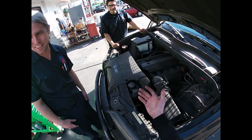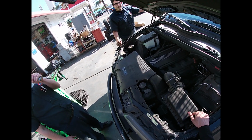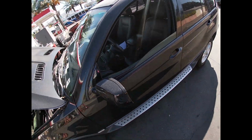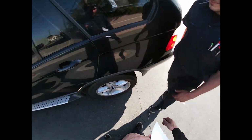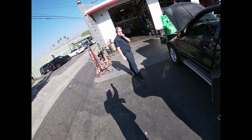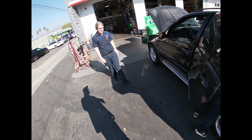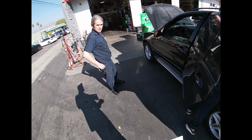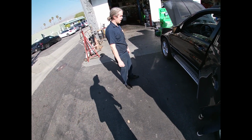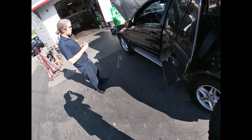Whoa. So, dude, I'm just spoon feeding my information. How do I disable the fuel? What's the easiest way? This is awesome. Well, if it was a Ford, it had a rollover valve. That's where I've been disconnecting them. Is that what you've been using? I used to go to the rear where the module is and just unbolt the ground that's right next to it. But like I had a car where it's on the ground. I'm like, I can't get on the lift. I'm just gonna go to the behind the kick panel. I had to take the kick panel off, but then unplug it and I'm done. Oh, you can do that too. I like to undo it.